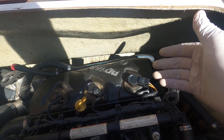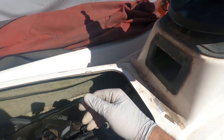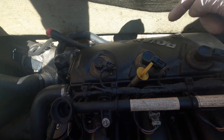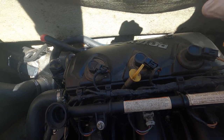After I installed the starter back, every time you hit it, it feels like the starter wants to kick in. So I'm not sure if it's a locked motor or not. What we're going to try is to remove the coils, remove the spark plugs, and see if we can turn the engine by hand.